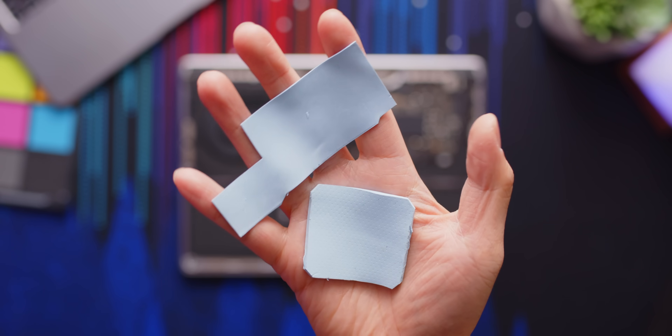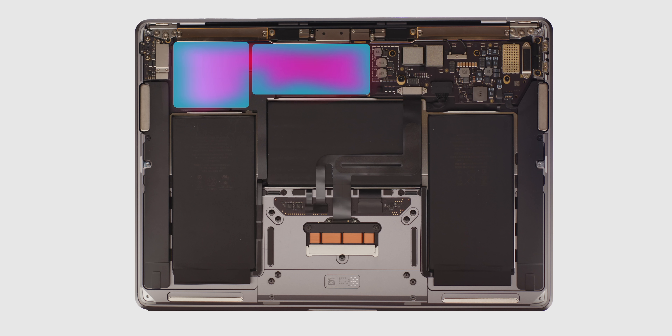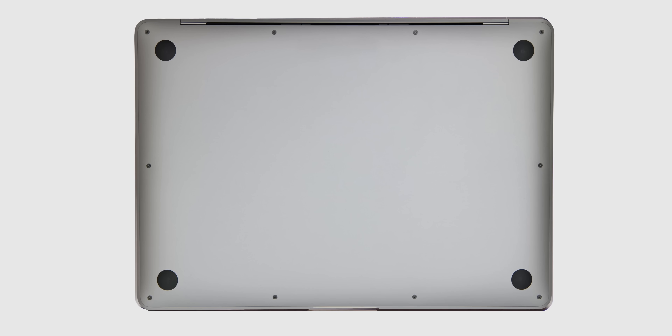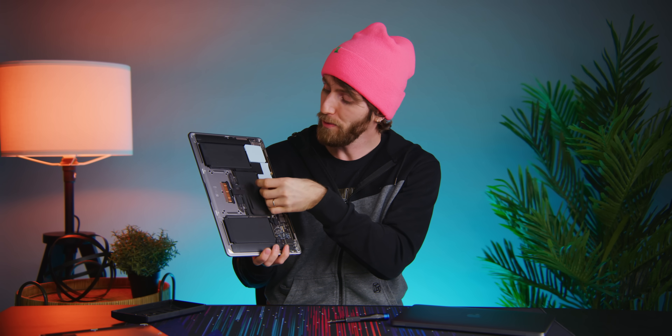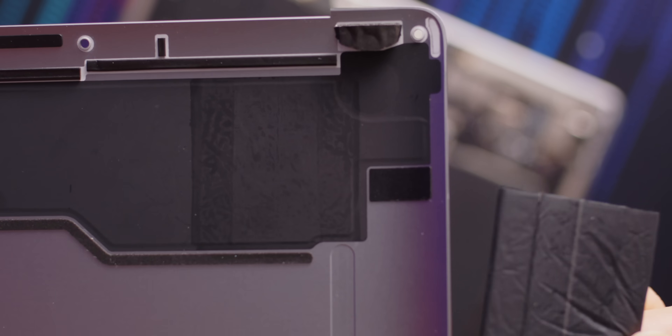Well, that — I'm glad you asked — is where these come in. These are thermal pads and they're designed to move heat around. This one is really squishy. All we have to do is slap these bad boys between the heat sink and the bottom of the chassis. We'll turn the back panel — which conveniently is made of aluminum, which happens to be great for dissipating heat — into one big heat sink. All we need to do to make room for it is take off this insulating sponge right here. Easy peasy.